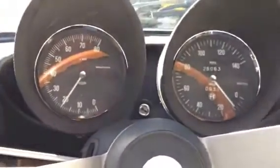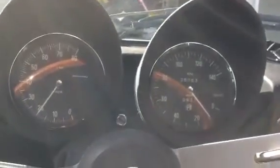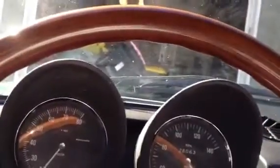So I have not adjusted my cold start solenoid at all — I just don't have the right tool, the crow's foot or whatever, to get to it. The TA really didn't require any adjustment when I went through the setup yesterday. The butterflies are all even. I've checked to make sure that they are just closed whenever the accelerator isn't hit.